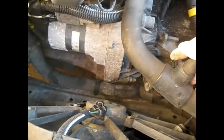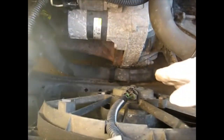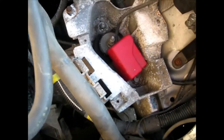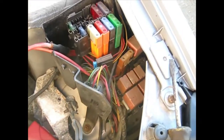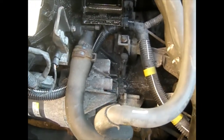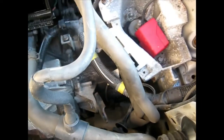Now you've got these pipes in the way, the wiring, but look down here, look, that pipe there, this wire here, the aircon compressor, the alternator wiring, those all need to be disconnected next, because they're all in this front section. And the wiring loom goes into that box. Now the loom is attached throughout the engine, but it looks as if it's quite involved to physically disconnect it at that box. So I may have to disconnect the loom from every single thing on the engine. Not desirable. We'll see how we get on.